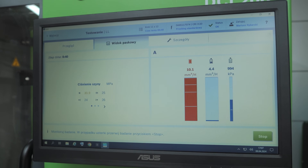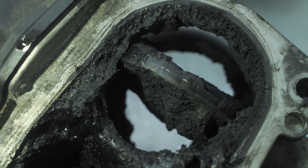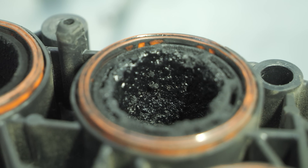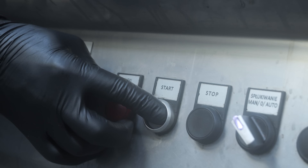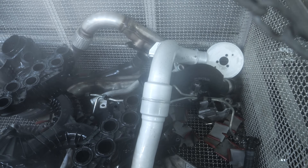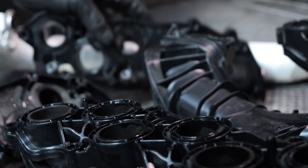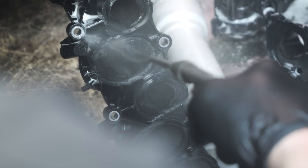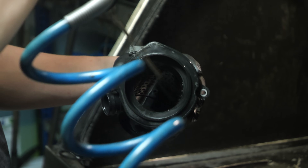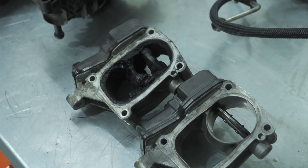There is also a separate video on our channel about common rail injectors. Another component that we will transfer to the new engine is the entire intake system. These components need a solid cleaning of the carbon build-up that restricts airflow. We have professional parts washers, ultrasonic washers, and a chamber washer in our workshop area. This ensures that all components are thoroughly cleaned before reassembly. Components containing electronics, such as dampers or flaps, are cleaned by hand.